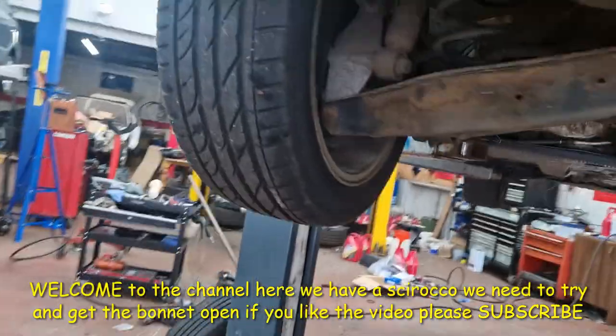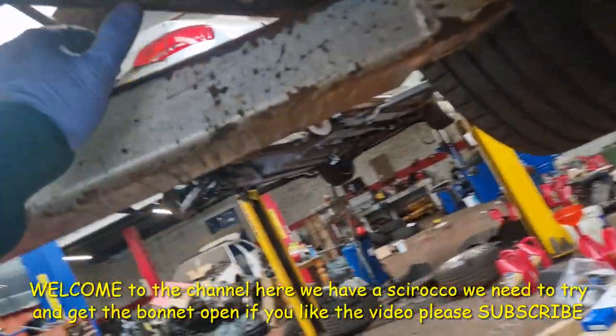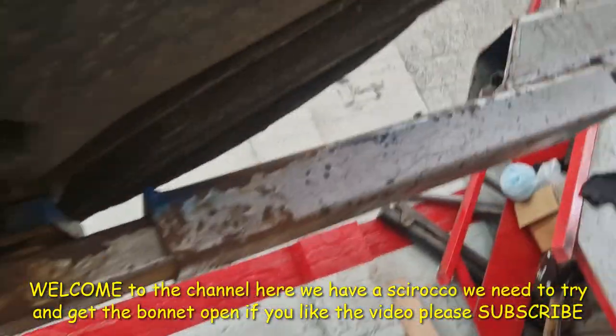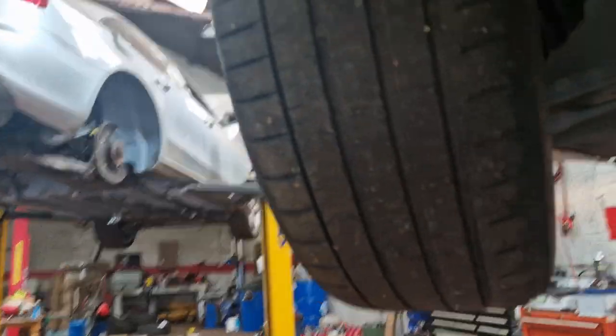They're quite rusty. It's quite rusty on the subframe, and let me show you a wee bit of the sill. See, this bit's doing the same, right? This bit is really bad, look at that. So the underseal is all coming off, so that would all need cleaned, treated and redone.